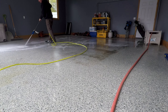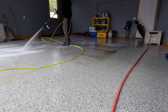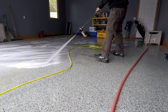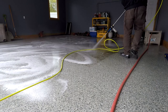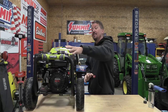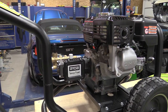This unit has the GX200 Honda engine, which is great. It has forged internals, a net of 5.5 horsepower, and it's a great motor. You'll hear of people taking this engine and putting it in golf carts or modding it — it will last a very long time if maintained well. It also has a very large metal gas tank on top that holds about 0.8 gallons of fuel, so this thing can run for a very long time without issue.